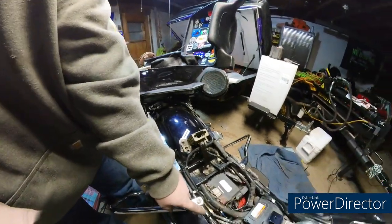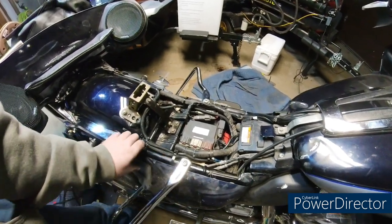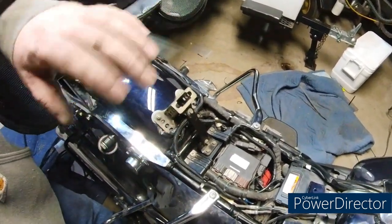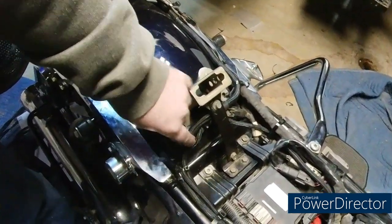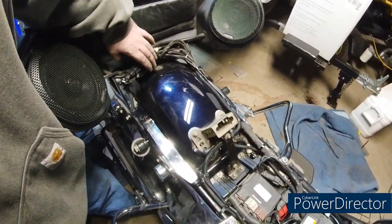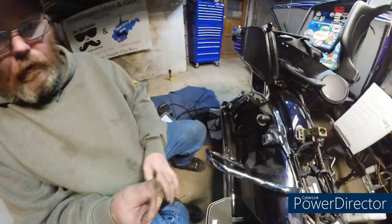Here's what we came up with. We ran the isolator and CAN bus down under here - it's out here in the side cover. I had to test fit the side cover because the heated grip harness and all that stuff - trying to stuff all that in there. If you're just doing this harness fine, if you don't have heated grips or other accessories. We added wire, wrapped it up real nice and neat. Came under the backrest mount. All zip tied - should have enough room to get our seat bolt in, and that's that. That's how we did that one.